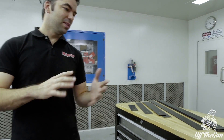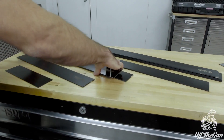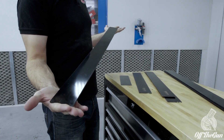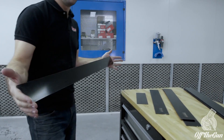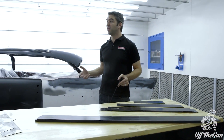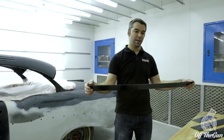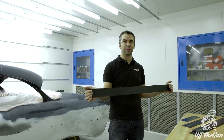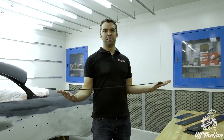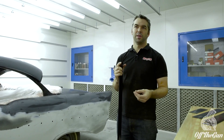So we've got these splines — this is what they are. They're a long tool that we make for specialised work. The amount of flexibility these things offer is just ridiculous. They can be used anywhere from panel alignment, setup, gapping, filler work, dry blocking and wet sanding. By far, although simple in the way they appear, they are simply the most accurate tool you'll ever use for bodywork. Effectively, the word spline means to generate a smooth curve, so we call the tools splines because that's what they do — they make a smooth curve.